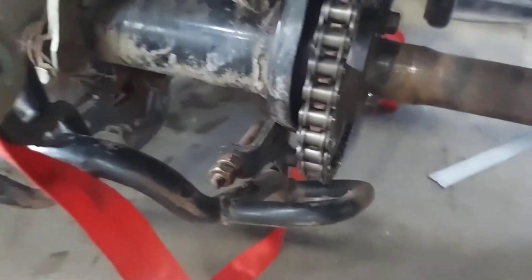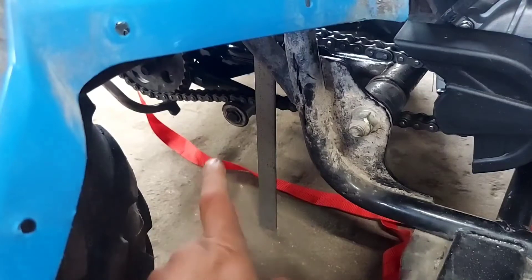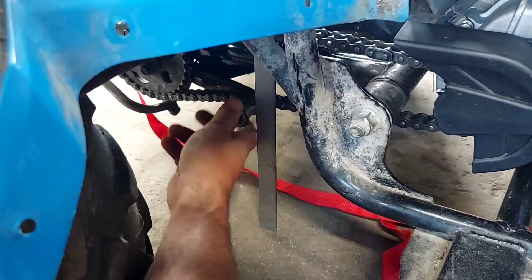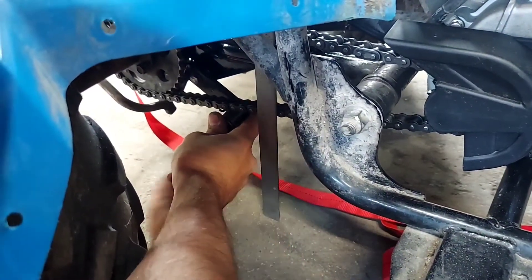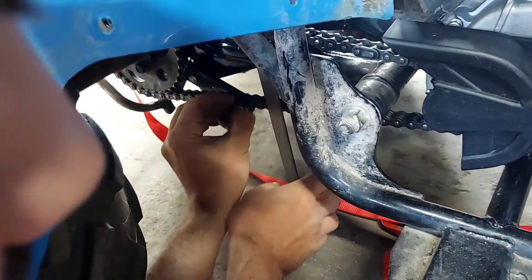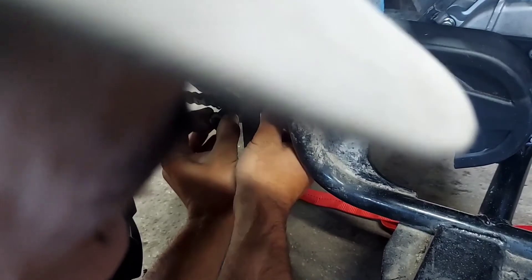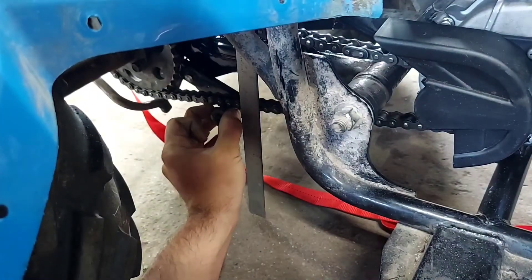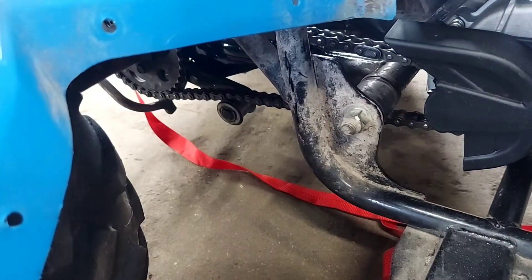So in that case, I'm going to come back here and tighten this up until it's correct. I tightened up that adjustment bolt, and now I'm just going to pull down this tensioner and get that out of the picture. Then I got my ruler here and put a little bit of tension on it — I got about a quarter inch. The spec is quarter inch to half inch slack, so I think that's perfect.